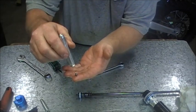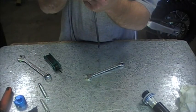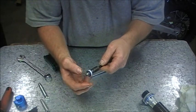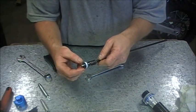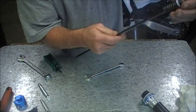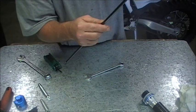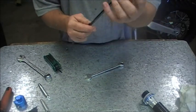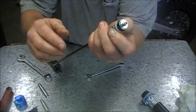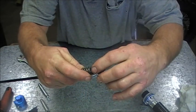It's just a case of taking the new part, putting the needle in, and cleaning these threads with a bit of cleaner. They come from the factory with a little smear of painted-on Loctite. Just a tiny dab of blue Loctite — not very much, just enough to grab. Make sure you clear the oil off. Now, these shims underneath the rebound have a bigger centre hole and they all fit over the boss on the rebound tap. If you don't get them over there, you're going to squash them when you tighten up. So make sure that they have all gone down over this.